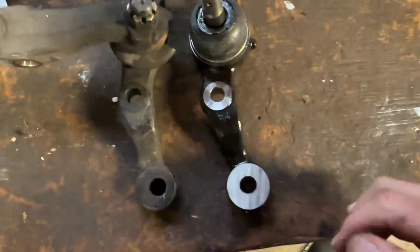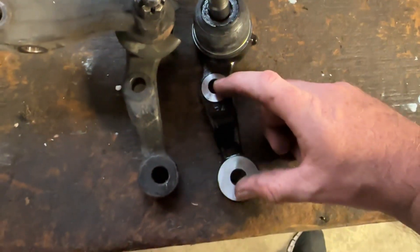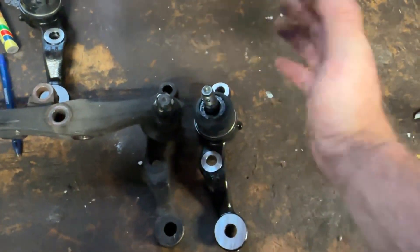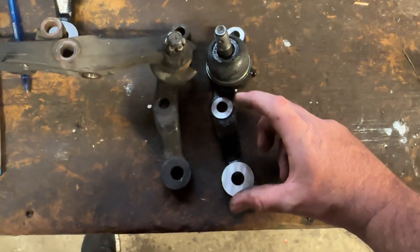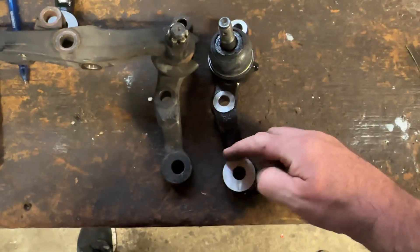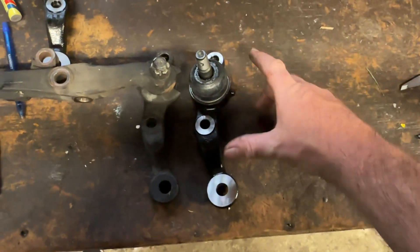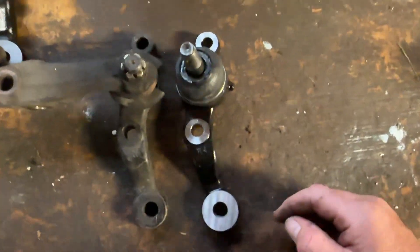The first thing I noticed was this arm is ever so slightly longer. This is where your upright goes on your hub and then your wheel, and your steering arm attaches here. With shortened knuckles, what they do is take these factory ones, chop it here, chop it here, and weld this onto here — or like Hayman knuckles, which are this piece but just with this distance shorter.